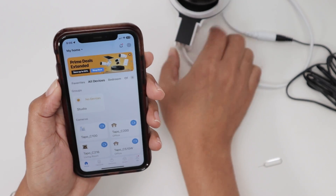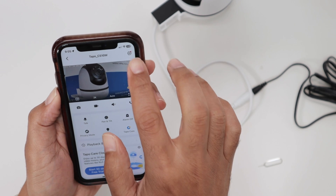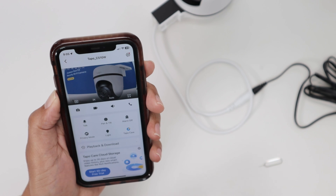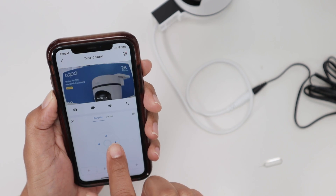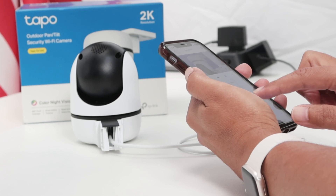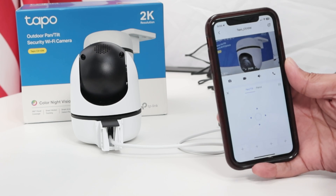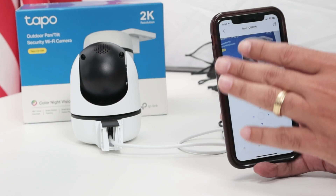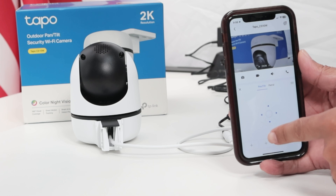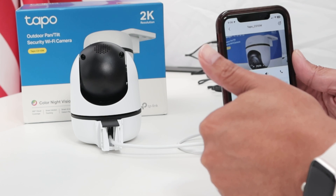I'll put it back there one more time. Right now it's upside down, which is the default after a factory reset. I need to go to video and display settings and invert the image. Then I can have the camera working in the correct position, and with pan and tilt I can control and move the camera. So different ways you can reset the camera — physically and remotely. Physically you can choose to keep settings or do a full factory reset, or remotely just remove the camera and it resets to factory default. I hope this helps. Please subscribe, leave a thumbs up and your comments, and I'll see you in the next video.